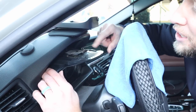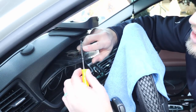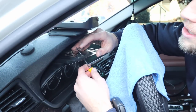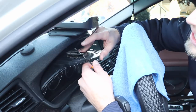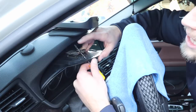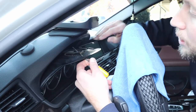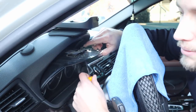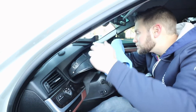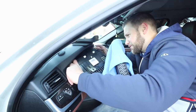Here you can see a side view of the clip we were loosening. You take your pick tool wrapped in electrical tape — the tape gives it something to bite into so it doesn't slip on bare metal — stick it in the second slot through the hole, pull down on both sides, then rock it out. Press in the bottom as you maneuver everything out because there's a little hook.